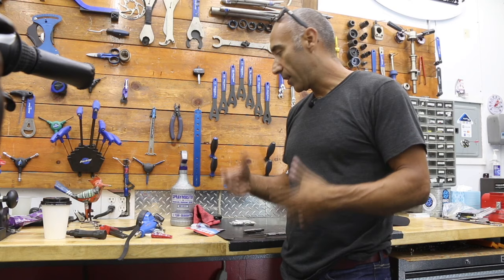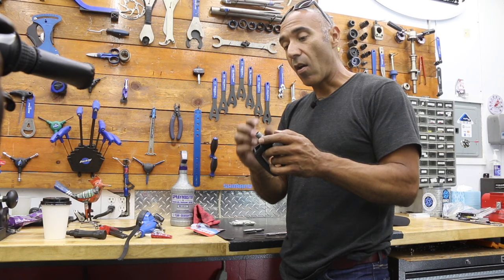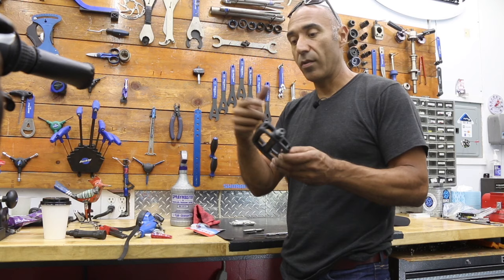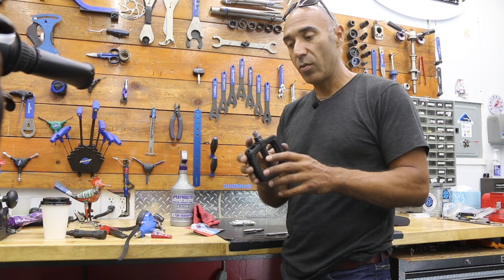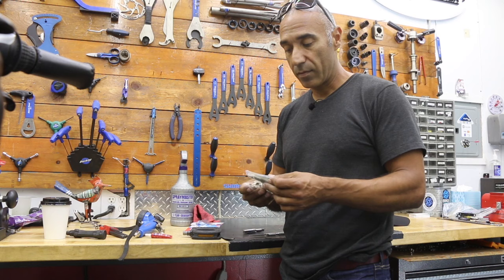Then we're going to go back and get our new pedal. You can check your original pedal — I cleaned it up with some paper towels. Looking at it, the threads look like they're in place. You can always test it on another crank arm — make sure you've got the right side, turn clockwise, get it started one or two turns, and if all the rest of the threads look good then most likely you can reuse the old pedal. A lot of pedals use hardened steel and crank arms are aluminum, so the pedal threads often survive. If you have any questions, hit me up in the comments, give a like, subscribe, and hit that notification bell.